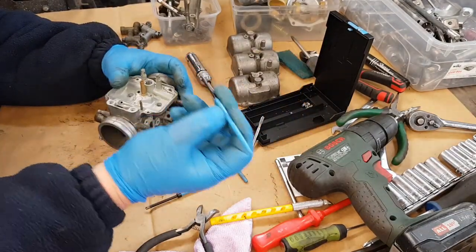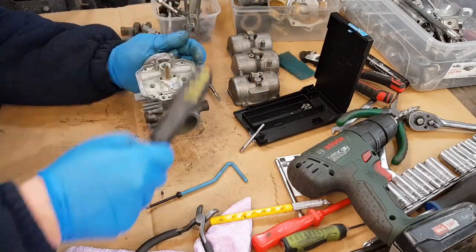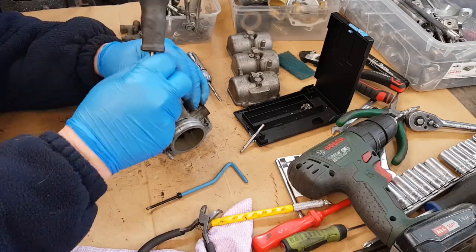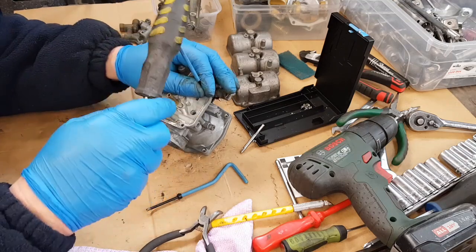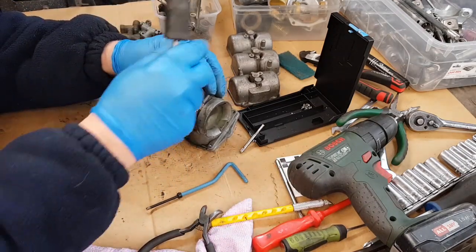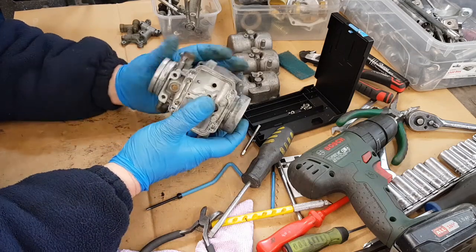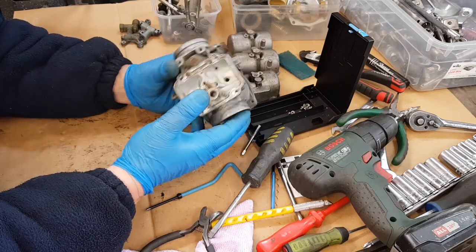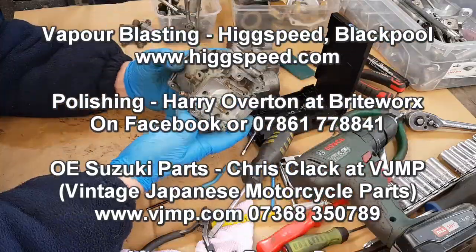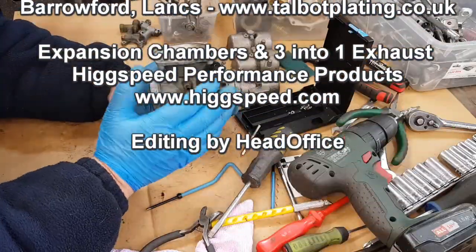All we've got to do now is snap the tangs off - that goes in there and then hit it with something a bit heavy. You need to remove the tangs because if you don't, the bottom of the bolt you're putting in will push against it and pull the thread out - so very important. That one took less than five minutes. Obviously if you're doing them all together in one run, you drill them all first, then tap them all, then helicoil all of them. I hope that's been of assistance to you. If you're enjoying these videos and learning something from them, please like and subscribe.